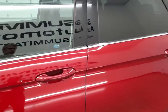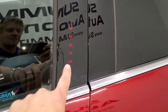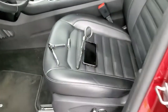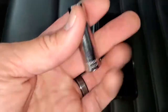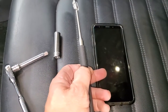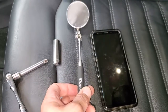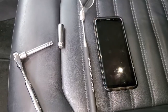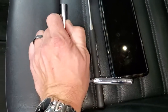This is probably the most difficult door code find that I can do. We're going to be finding the code for this keypad, and it's printed on a sticker inside your car. You're going to need a couple tools: a ratchet, an extension, and a 10 millimeter socket. You may want a mirror on a stick, or you can use your cell phone with the flashlight to take a video behind the sticker. I think the mirror on the stick is a little bit easier.